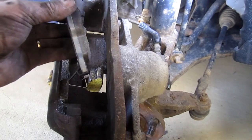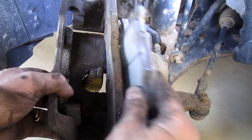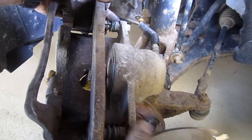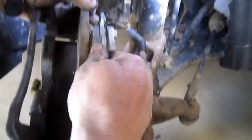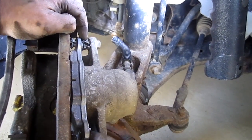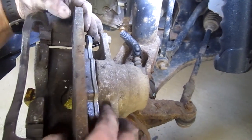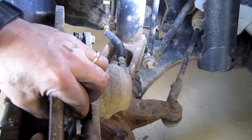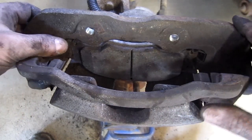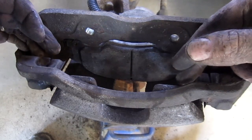For the inner pad, we're going to feed it in from the back. You need to get a little bit of space — slide your caliper bracket out like that — then drop your pad down in and get these edges into the little slides. That's what it should look like when the brake pad is in place: these little ears slide into position.